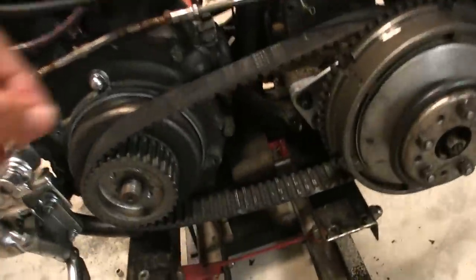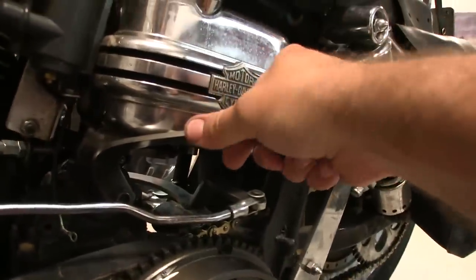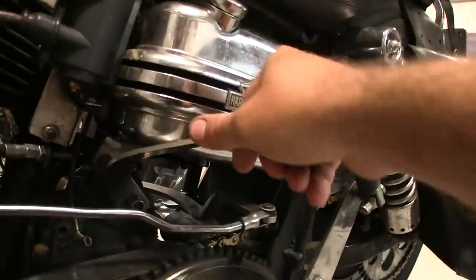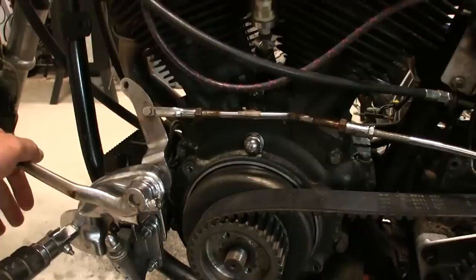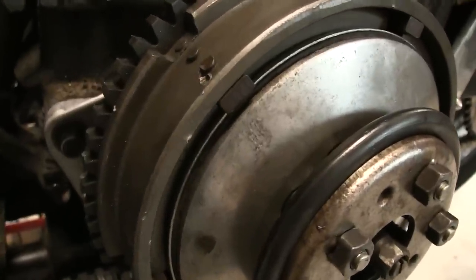Fast forward a lot, because I really didn't film what I did — to be honest I didn't really know what I was doing. The belt's a bit loose: the other belt was too short so I put the stock one on just to get a visual. I got my jockey shift in there and it seems to work — that's first, that's neutral in theory. I've got linkages hooked up from my pile of parts and the clutch works pretty good — you can see the pressure plate coming in and out.